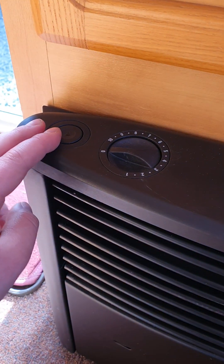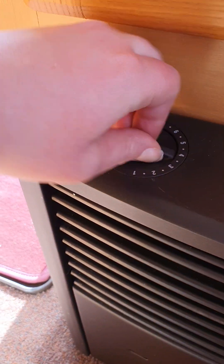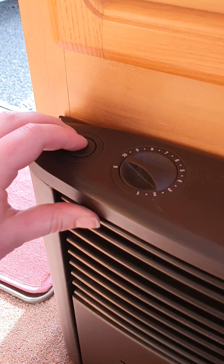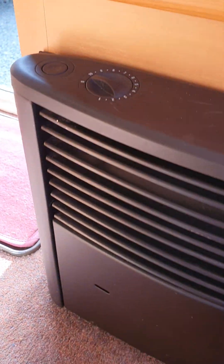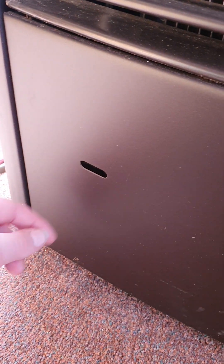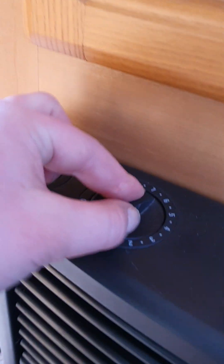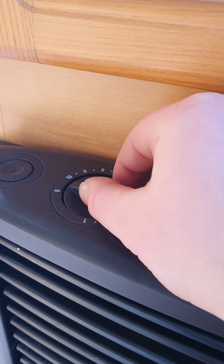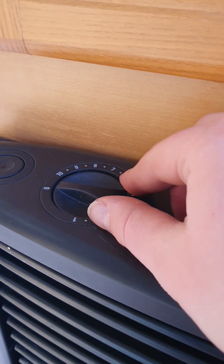On the left of the heater unit is to run your room heater on gas. Spin this dial up quite high to about 10 — this is also your purge button, so push and hold that in, then hit your igniter. While you're doing that, have a look at your sight glass, which is about 25mm in and matches the shape of the little hole so you can look through while holding the purge button and hitting the igniter. Just like the fridge, you should see a small blue flame, then once you hold the purge button for a couple more seconds and release, it should kick into a bright orange flame so you know your heater has ignited. You can then adjust your temperature from one right around to 10. To turn the heater off on gas, find the zero and push it ever so slightly past the zero — almost as if it's going back around to 10 — and that'll make sure the heater is turned off.